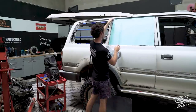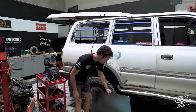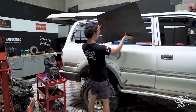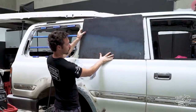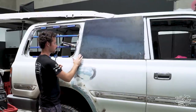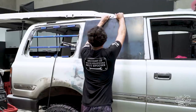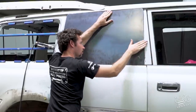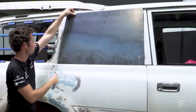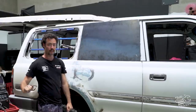The lines weren't amazing hand-drawn, but I ended up heading to a mate's shop and used his guillotine and brake press to get the lines a lot straighter. Here we go with a piece of 1.6mm steel. I've just checked it, a couple of little notches had to come out, but it's looking pretty flush. The plan is to tack on that bottom end and work the tacks up the side, pulling the top down, so it follows that nice curve of the original body.